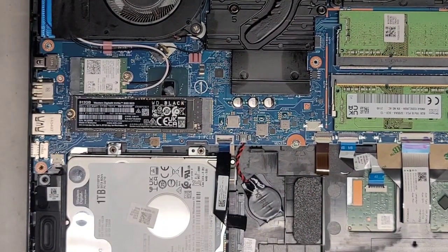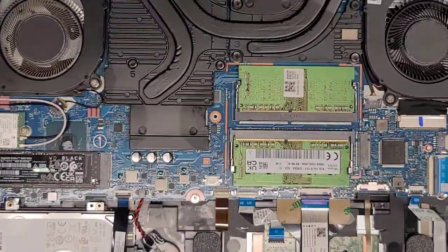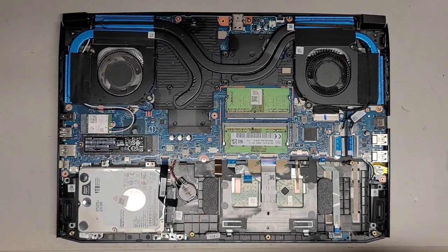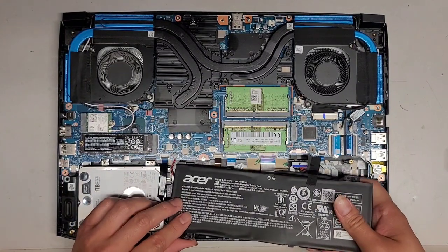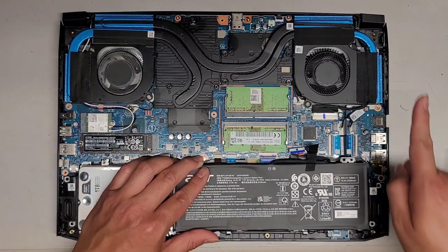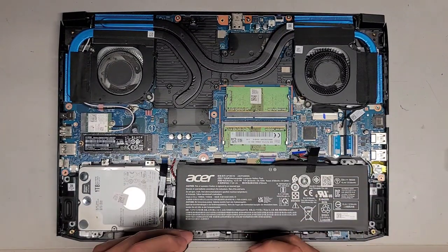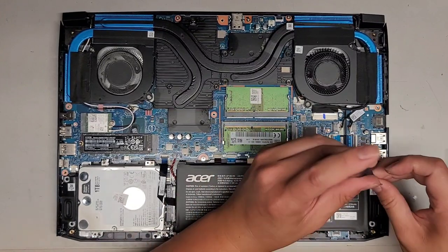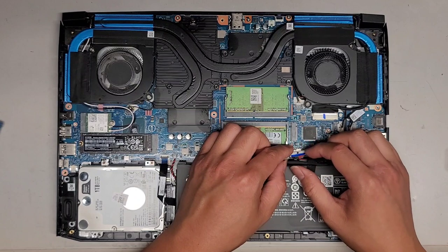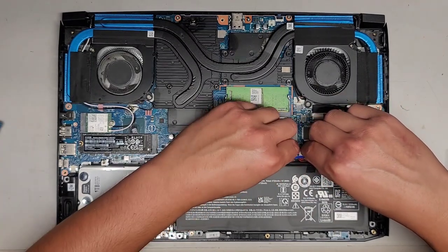I think we've got all the screws in and everything in except for the battery. We'll do one last quick check — everything looks okay. Hopefully we don't need the charger to turn this back on, but we'll see. It did actually turn on when I was accidentally cleaning the keyboard, but usually with liquid damage you don't want to do that. We're going to reconnect the battery. Especially since we disconnected the CMOS BIOS RTC battery, a lot of times the computer might not turn on right away, or it will take several boot cycles — it'll restart itself automatically several times before it completely starts up. Keep that in mind.